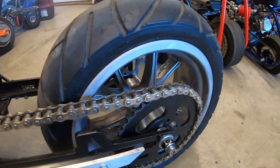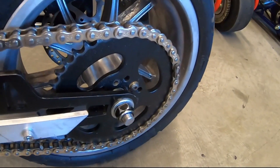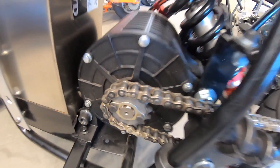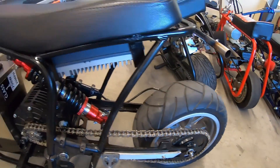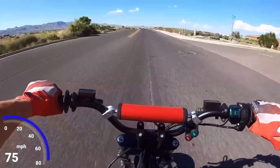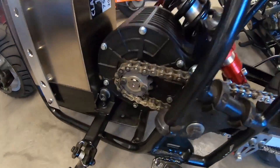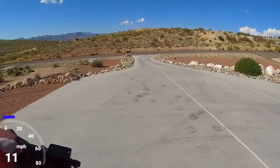On this build I'm running a 14.5 inch tall tire with a 40 tooth rear sprocket. The kit comes with a 10 tooth motor sprocket, and with a 10 tooth and the short rear tire this thing had massive torque on takeoff. To calm that down and add a little top speed, I added a 14 tooth motor sprocket. With the 14/40 gearing, the bike achieved its 76 mile an hour top speed but still does around two seconds from 0 to 30.